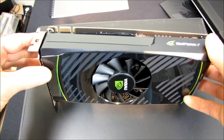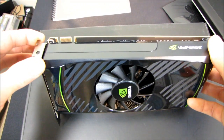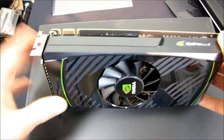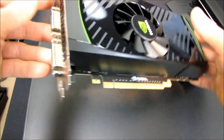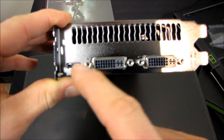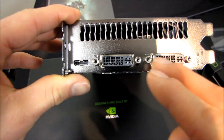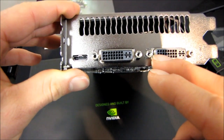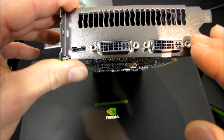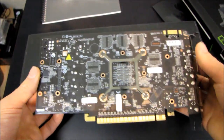We've got an SLI connector, so this card is SLI ready, but that is two-way SLI and not three-way SLI — just so you're aware — because it's only got a single connector. On the back, we find a mini HDMI as well as two DVI connectors. Please do note you can only use any two of these three connectors at any given time. If you install two cards in your system, you can run three monitors off the two cards together to run NVIDIA Surround with up to three monitors.